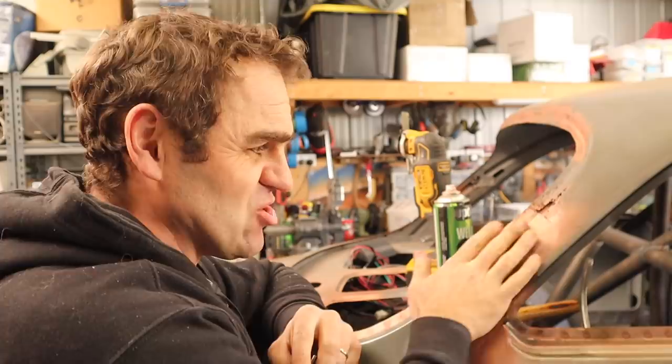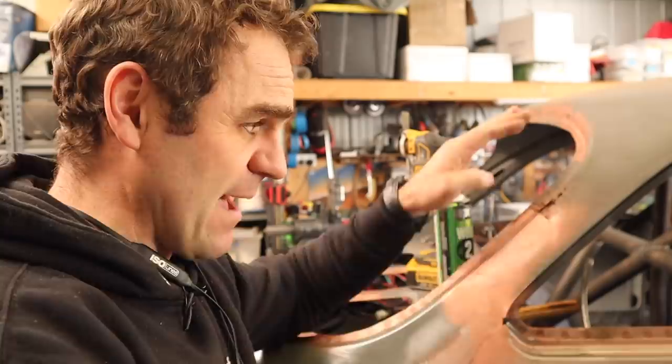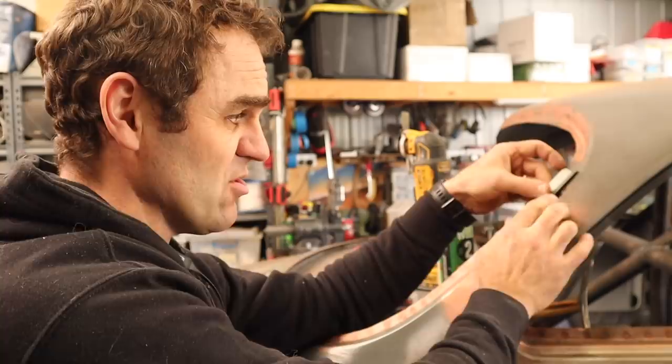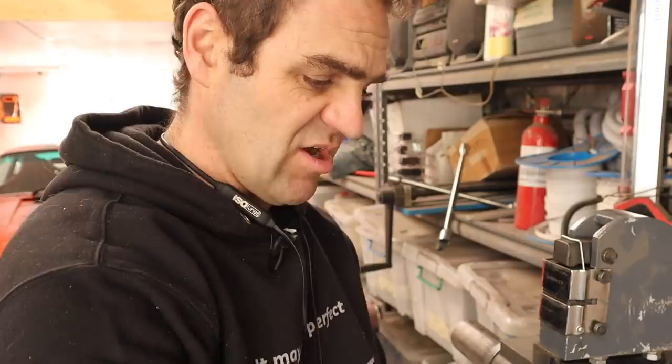I've put this first patch in — it's a reasonably straight section. I used the shrinker stretcher a little bit to get a little bit of shape there. I need to work a bit harder up the top corner to get a piece in. I was going to try and do one piece for the whole thing, but it would be too straight and wouldn't match the curves. You can't do a three-layer piece with two folds because you can't stretch the bit in the middle. That's why I've done the angled bit first, then I'll do a flat panel over the top.